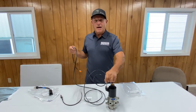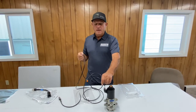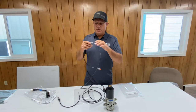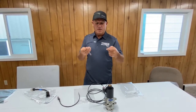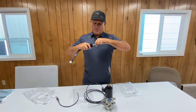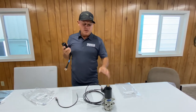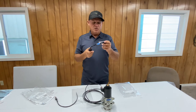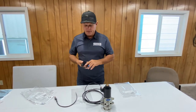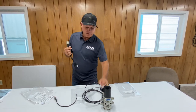If the cable is too long, just wrap and loop it with a tie wrap. That'll buy you some time if you accidentally leave it connected and drive away — it'll pull the loop and snap the tie wrap off, so you'll hopefully catch yourself before you tear the whole thing apart. Once you've got this Deutsch connector, just plug it in and go. Only use this when you're running an attachment — when you're done, unplug it and put it somewhere safe because it is expensive.